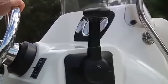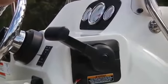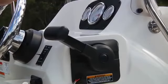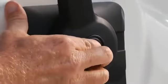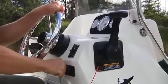Now you're ready for the starting procedure. Place the shifter in the neutral position — that will be in the middle of the shifter range and you'll feel a detent when you shift to it. You'll have an in-gear release button. Push this button and advance the throttle. You'll stay in neutral, but the engine will be getting more gas for the start.